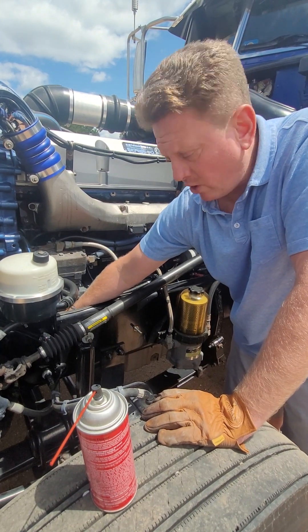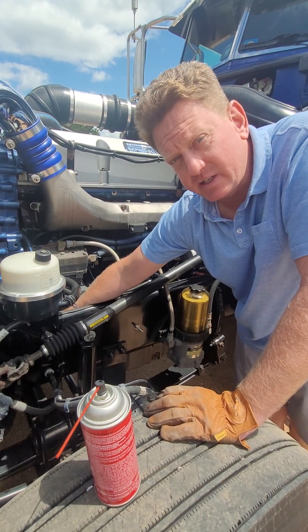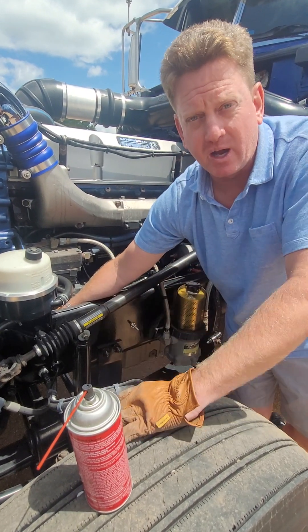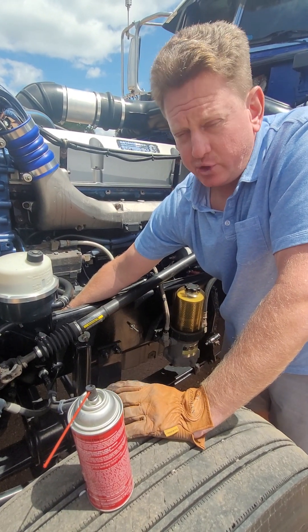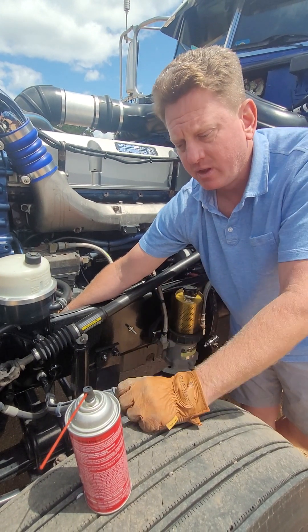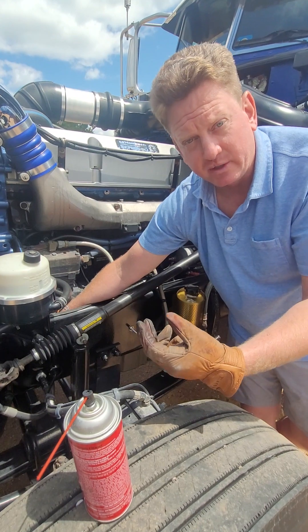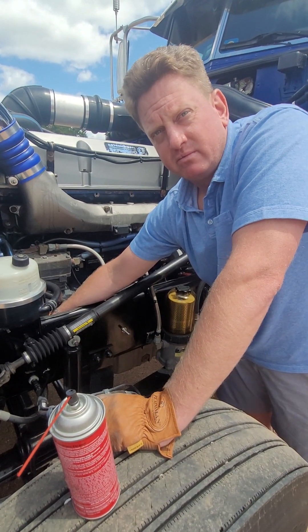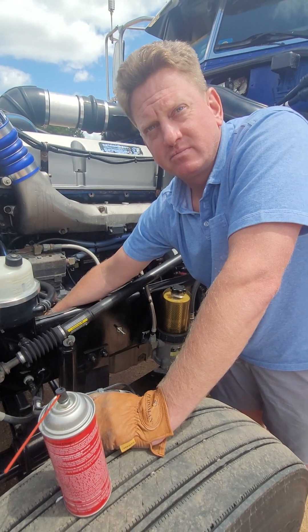Check these connections and make sure your sensors are good. There's one bolt that holds them into the front casing and into the block. Pull that one bolt and pry them out with a small pry bar. You can then inspect them — make sure there's no metal on the end of them and make sure they're not chipped or broken. If they are, replace them.